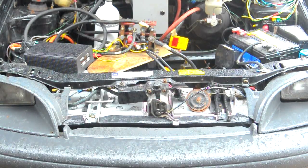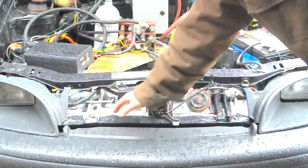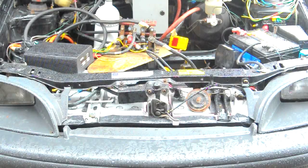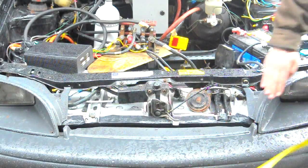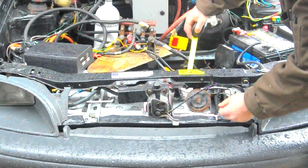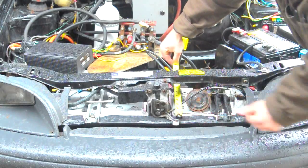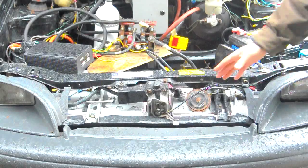There are two batteries installed in the front of the car — one here and one here. Those batteries are about seven inches by 13 inches. If I turn them sideways and have four of them across, that comes to 28 inches, which will exactly fit between the headlight buckets. And then it's 13 inches long, which basically comes from the front straight back to the motor and transmission. So by just turning these two batteries I should be able to fit four of them in front total — four in the front, four in the middle, four in the back for 12 batteries.